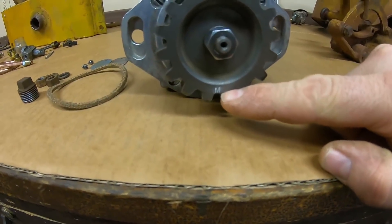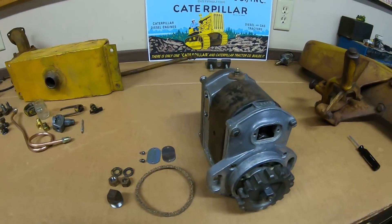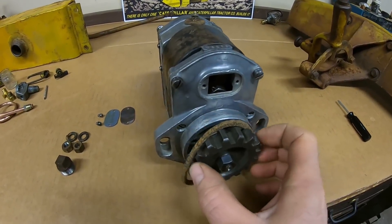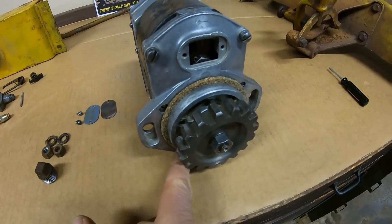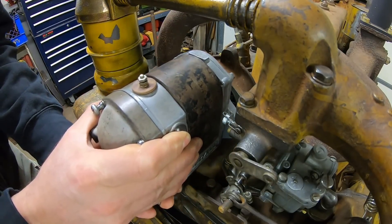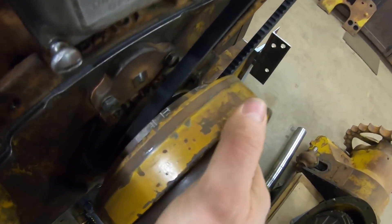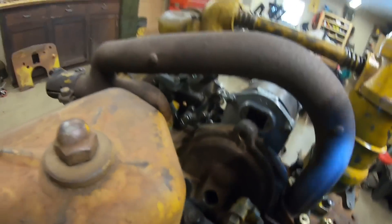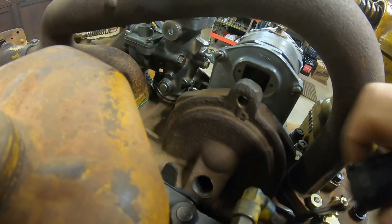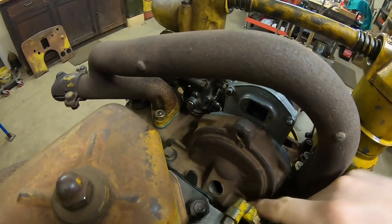Let's get the magneto put on. We're going to align the M mark on the mag gear with the M mark on the cam gear. The window is off the front because we're going to do one last timing check of the cam, and this cork ring seal goes on the front. I can see both of the M marks lined up in there. Now I'll roll it from the top center mark to the mag mark so it's in line with the scribe on the cover and look in through the window — yes, that white timing mark on the gear is in line with the pointer arrow in the center of the opening. We're good for timing.